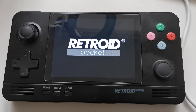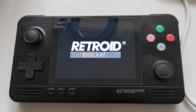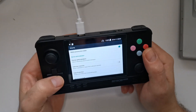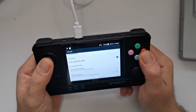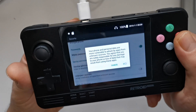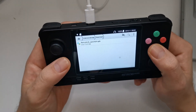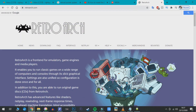The first time you boot this up it takes a while, so just be patient — it won't take this long next time. Once it's ready to go, the first thing I like to do with a freshly updated firmware is make sure Unknown Sources is enabled by going to the Security settings and toggling it on, so you can install apps from the PC.